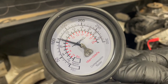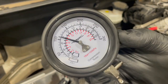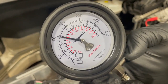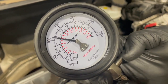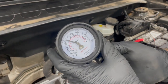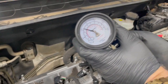Pretty simple to do a compression test, but you have to think of all the different places that compression could be leaking out of the cylinder. You can do a cylinder leak-down test to help isolate where that pressure is going. For a compression test, take good notes — it's a real good indicator of the health of the engine. From this point all we've got to do is put it back together and proceed from there.